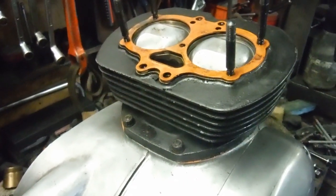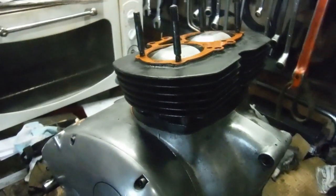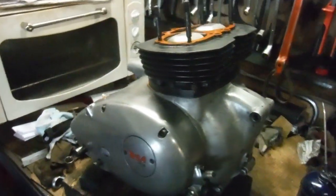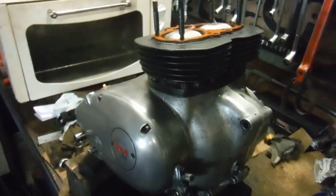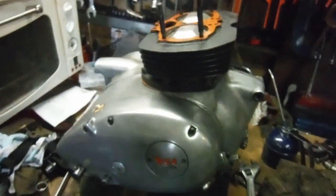I put the knife-sharp edge of the oil rings facing downwards and the chamfered edge facing upwards. So that's where we are now — next up is fitting the cylinder head and bolting that down, then fitting the valve gear, push rods and so on. After that I'll just be left with the primary drive components to deal with.